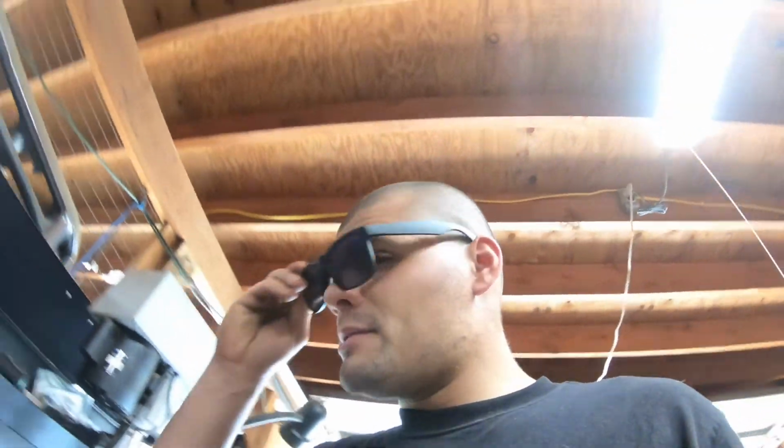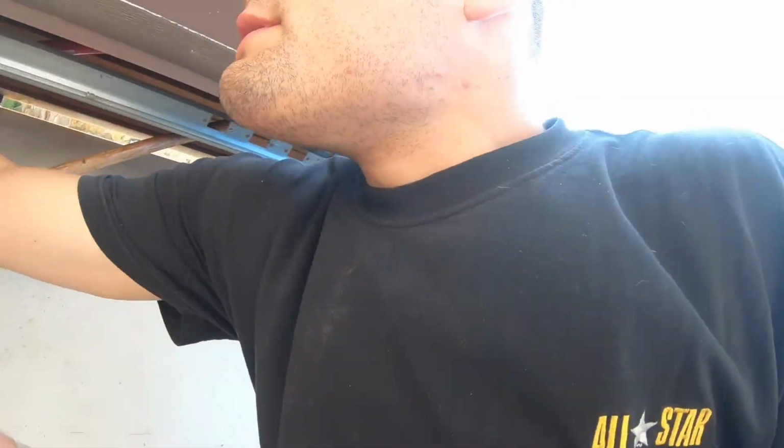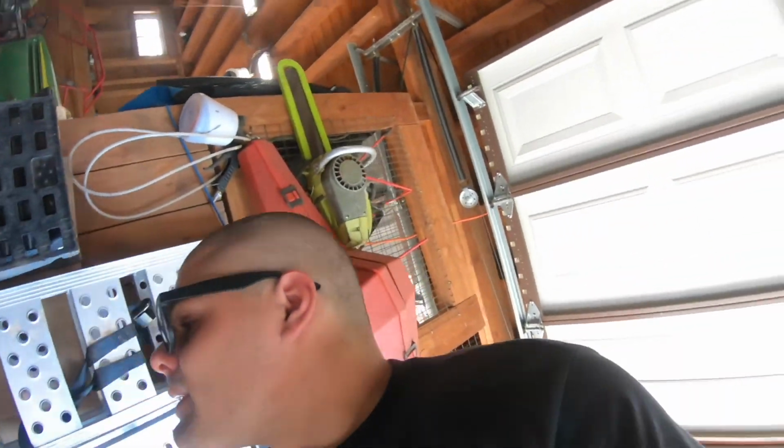Hey YouTube, Diesel Dan Peters here. So this is what we're running into now. Nothing too big, but we will have to bleed the system out. I'm assuming it's an 8, so we're gonna grab the 8. Let's see, I should have some DOT4 fluid as well. I already have a line I can use to drain. I guess what we need is like a little pan or something. Grab this. And I'm just gonna start to bleed it all out.